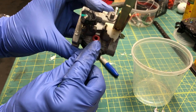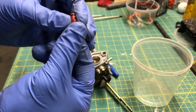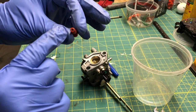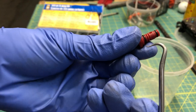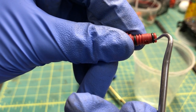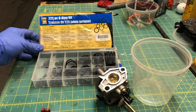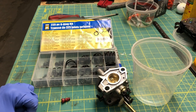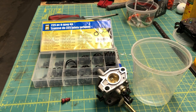Just put it back in there. There's a chance those O-rings can rot out, so keep an eye on those. There's a little opening in there — make sure it's not plugged. Upon closer inspection, one of these is already cracked — unbelievable. Luckily, there might be something at Princess Auto to match it up as a replacement. Otherwise we might have to order a carb kit for it — wouldn't hurt anyway to have spare parts given the poor quality of some of these components.